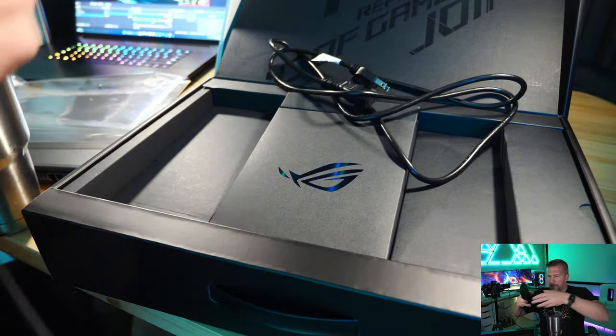The Armory Crate app allows us to do a lot of different things, like change the performance mode. You can do silent, performance, turbo. Those are the three default modes. And then you have manual fan mode, where you can set your own fan curves. You also have your PL1 and PL2 power limits. We're going to set this up to maximum. We're going to set our manual fans by dragging the left node up, and the left node up here as well, and move all those up.